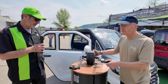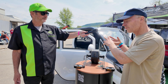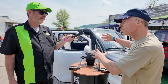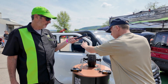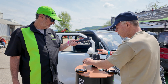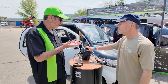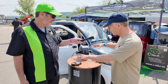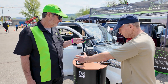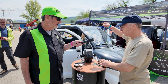All the heavy cargo bikes, like the other models, were driven by a generator which produces the electricity for the battery and also the steering signal for the engine to drive. And normally it's like pedaling — like a bicycle. We made it only for a step version, so you can put it like this. Is this a pedal generating system? Like the 60 idea — yes, like the 60 idea, but modified not to a full pedal rotation, only to make a step move. Because you need less space for the feet, and in the cars it's more complicated to integrate a big pedaling system.